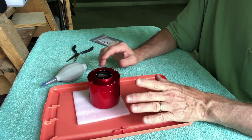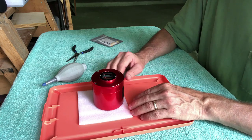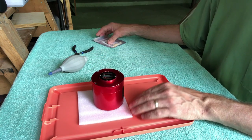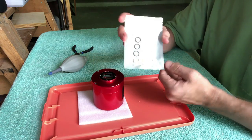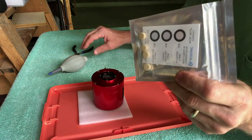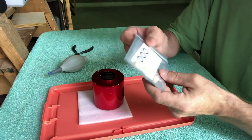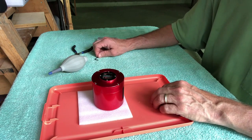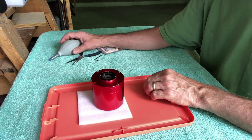I'm not actually going to take it apart because it's fixed now. As the saying goes, if it ain't broke, don't fix it. But if and when it does happen again, I feel very confident I can do it. I actually ordered a new set of desiccant tablets — here they are sitting at the bottom. They're $20, but I think it's worth it. If it happens again, I have no problem taking it apart. I simply recharged the tablets and that seemed to have fixed it.